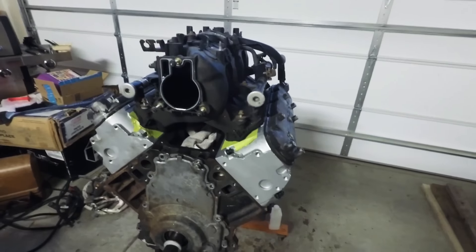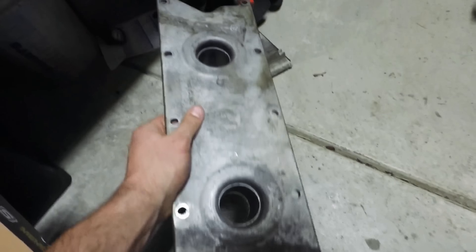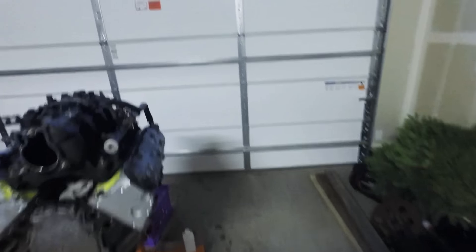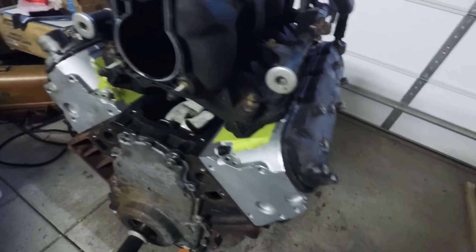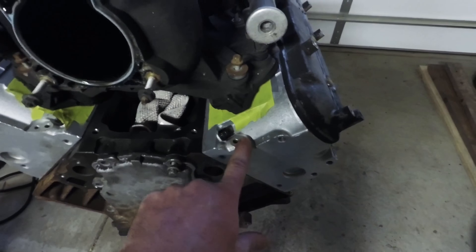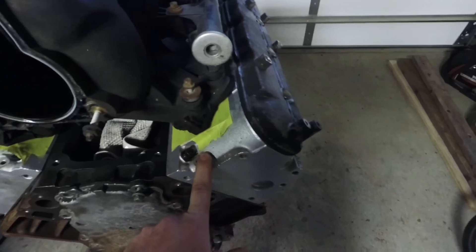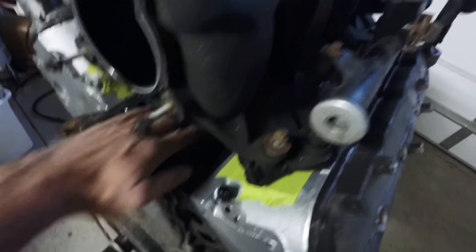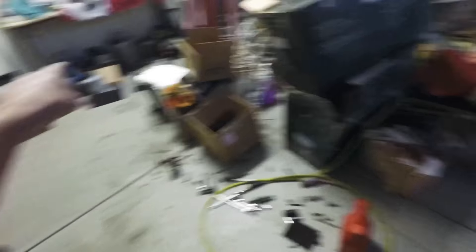Now I have this code — I'm sure a lot of people have had it. The knock sensors are underneath the intake manifold, and by design, if water gets in there there's nowhere for it to go. Mine were rusted out. The problem is these engines come from the factory with a steel tube that's supposed to get steam out of the heads. It has provisions for it in the back, but the back ones just have block-off plates. What happens is they leak, and the coolant leaks down in here and gets stuck in those knock sensor holes, and they rust out.